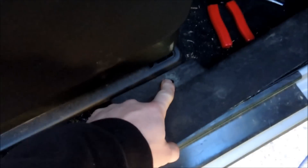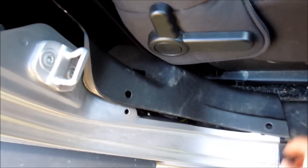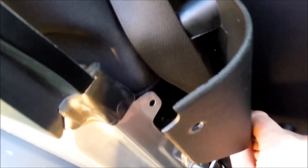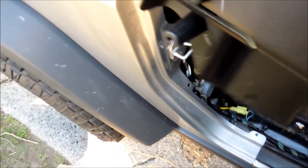When you're going to run the wiring you'll need to pop some Christmas tree clips — you'll see one here, one here, and one right here. Remove this first one; this would be on top of it if you're looking at your vehicle right now. Pull this one out and this will come out nice and simple. After you get this out you'll see that loop is where the seat belt would have been — slide that out. There are two pop clips probably still over there and those are what hold it in on the back. Pop it out by pulling on it.